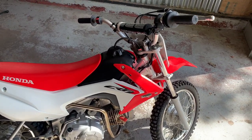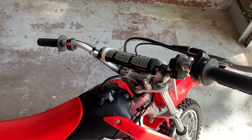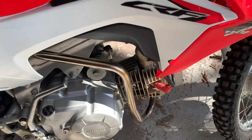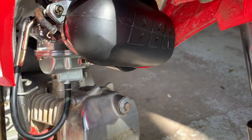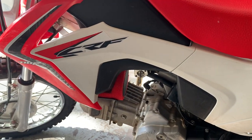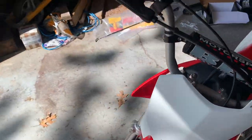Let's go through what I've done. I did a big bar kit by BBR and a larger handle grip by BBR as well. It came with the new brake and throttle cable, and then I also did an 18 millimeter carb — stock comes with a 13. I've got this new intake that turns the filter backwards so I can avoid what I was having earlier with the tire kicking up mud and water into the filter. The filter has a little shroud underneath it so if anything does get kicked up it protects the filter. And then other than that I did the FMF pipe.